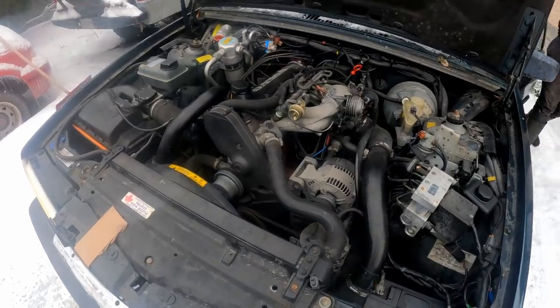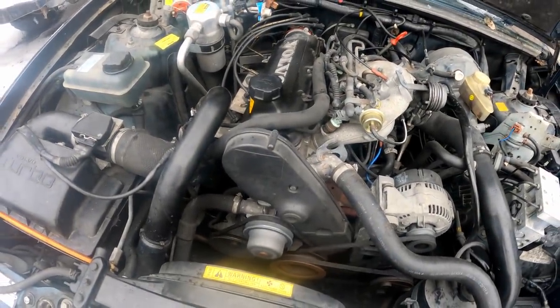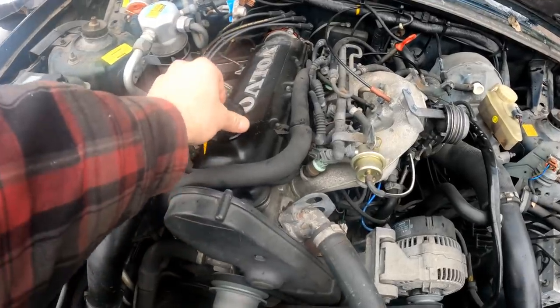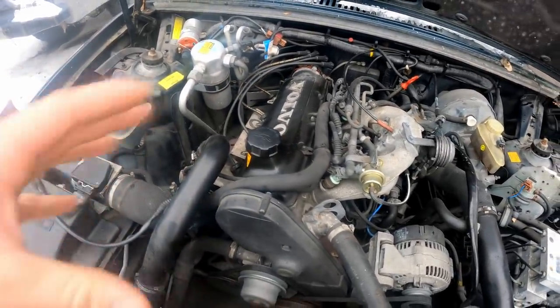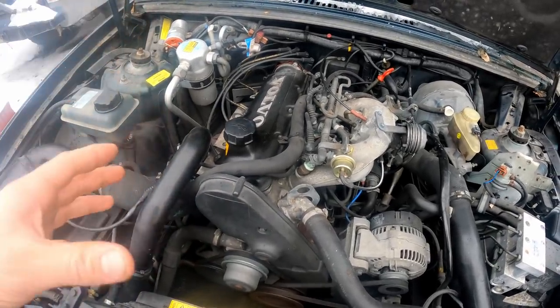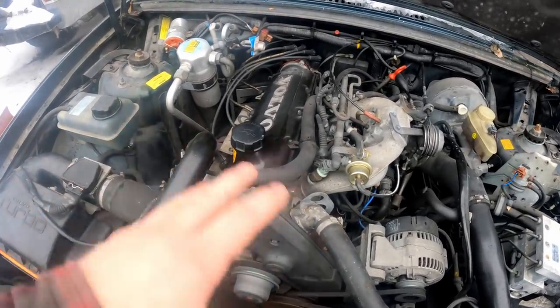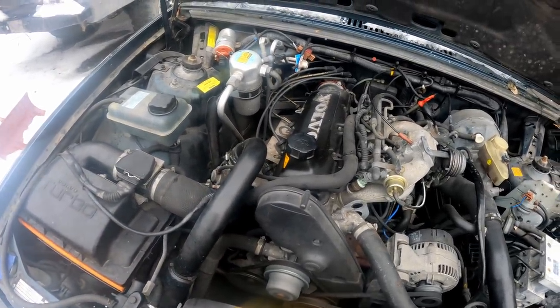We're going to head over to Post Haste and grab an engine stand, and then we can do some engine rebuilding stuff. Pretty smooth running red block, I would say. The thing about the 94 plus or any squirter motor generally in the 90s is that they don't really get piston slop because of the oil squirters. So almost every time you get one of these cars, the engine's really quiet and usually sounds really nice. Whereas the 80s cars will have some piston slap.